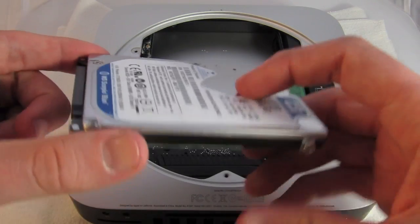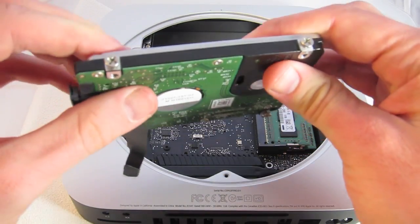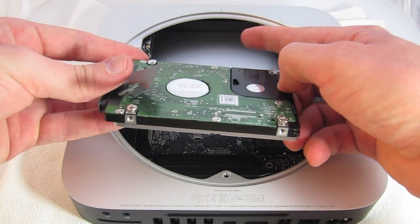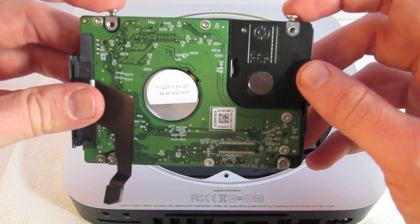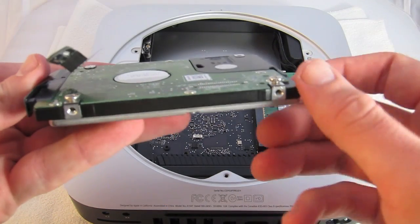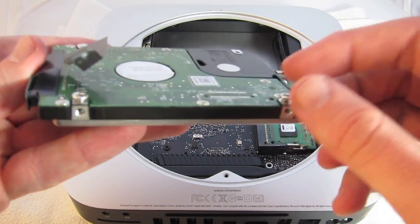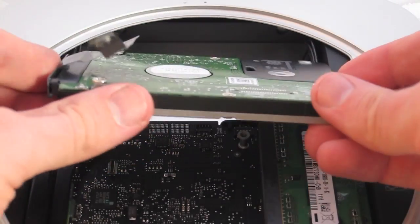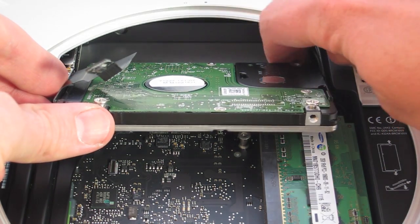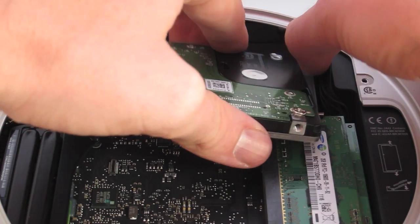Now I take my Western Digital blue drive. I attach the cable we purchased and I've put these screws in the sides so they align into the holes on the wall to keep the drive attached. I've also put these two screws here to provide a little spacer — keep them slightly unscrewed to provide spacing with the other hard drive. We're going to slide that in, keeping in mind to push the cables on the right all the way to the right so they don't get snagged.